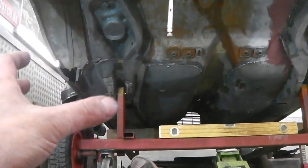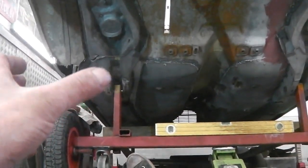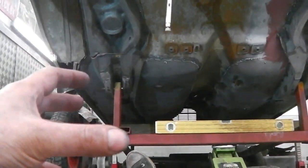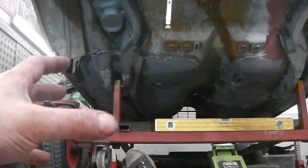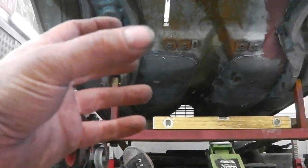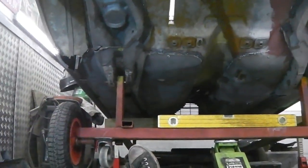And here, I didn't quite finish the butt weld. I just left it so there's a little bit of bend in it, then jacked it into the car and let it just slightly open a little bit just to follow the shape of the floor pan, rather than set it in stone, then put the chassis leg up and you find it's trying to push the floor pan up, or you're hammering the floor pan down.